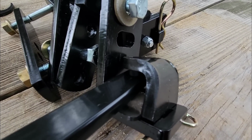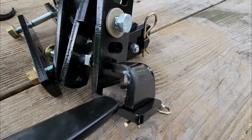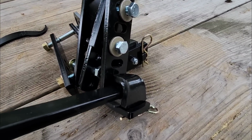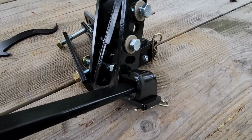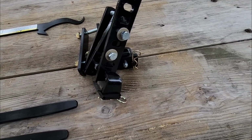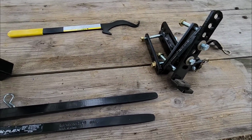If it's at an angle, then you're going to wear away just a small amount of the brake material and you're not going to have much surface contact. So you want it to be as flat as possible when it's sliding along those brake pads. I could probably take a clip out here and show you what I'm talking about. Okay, so let me walk you through it a little bit more.